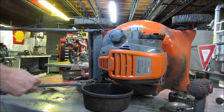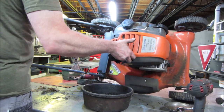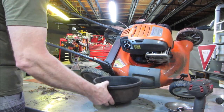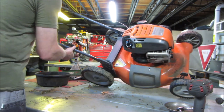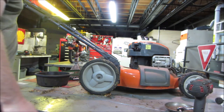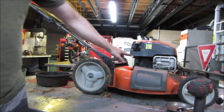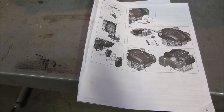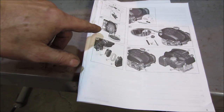Well, the one thing I guess, for the not being able to change the oil, the only thing I found is people overfilling them, not so much not changing them. Yeah, it's pretty cruddy. I had one mower I bought, smoking like crazy, and when I brought it home and looked at it, the dipstick showed they filled it to the top. It didn't say on the dipstick what it used for oil. Generally, it's like a 10W-30 or a straight 30. 10W-30 is what it takes.